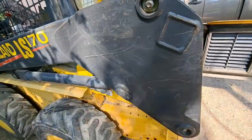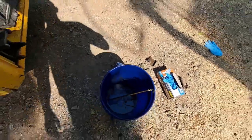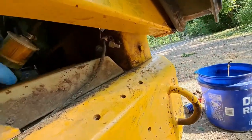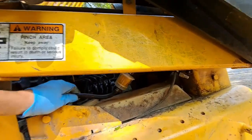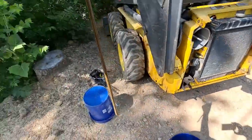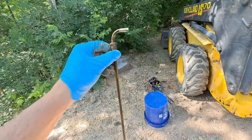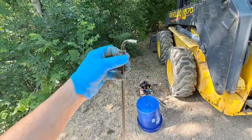I have an extra fuel pump and an extra fuel solenoid because I'm pretty sure it could not get any fuel — this pickup tube was blocked up. Another thing you might notice is when this is hooked up, it was vibrating. The pump was trying to work but it just couldn't get any flow because it was blocked at the bottom of the fuel pickup tube. That's all summarized in a few minutes based on this last week's worth of work. I hope this helps someone out there, and thank you for watching.